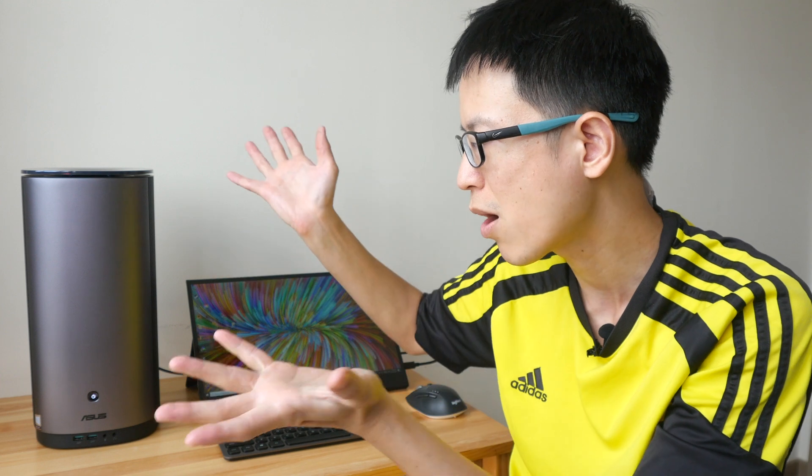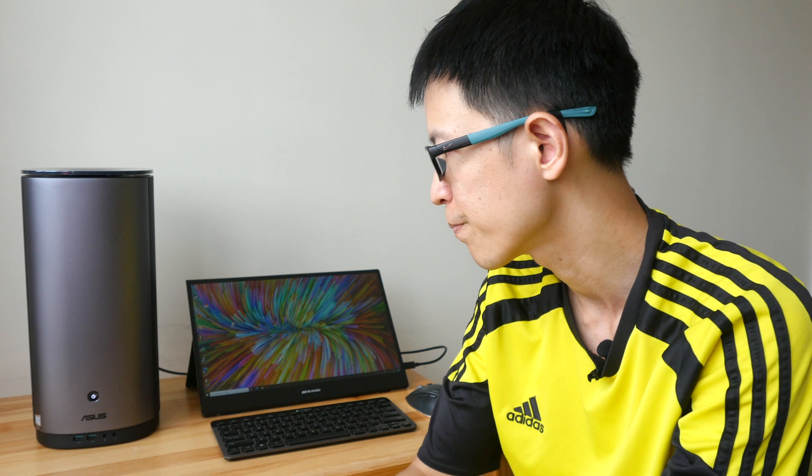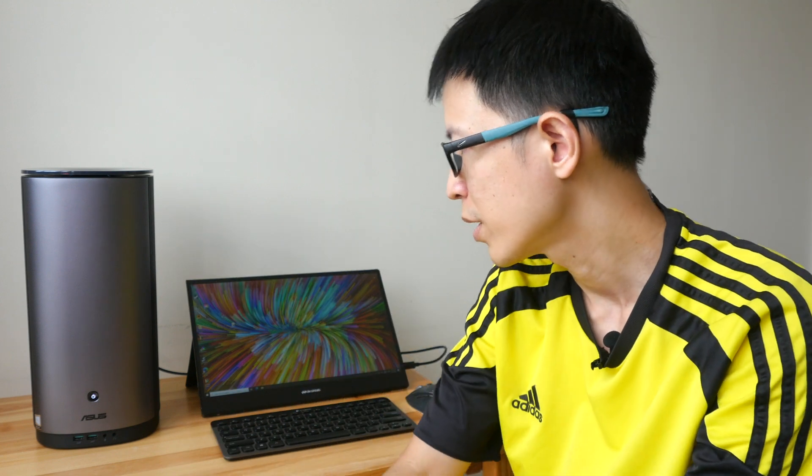Things I don't like: I don't like the lid that goes up and down — it's unnecessary and makes noise. The two humongous power bricks are also a downside. Another issue is the limited upgradability — when you buy a computer like this, don't expect to upgrade all the individual parts. The only upgrades you can do are RAM and inserting a 2.5-inch SSD. For storage expansion, you can use an external USB 3 or Thunderbolt 3 storage enclosure to get lots of additional storage.